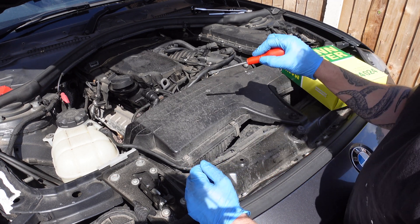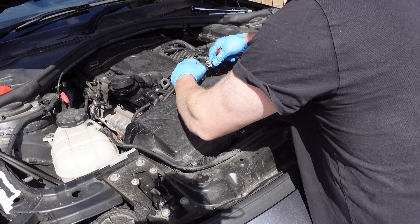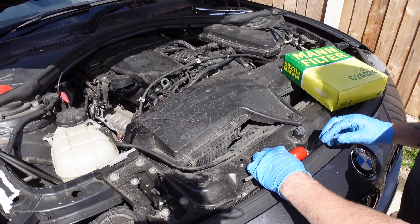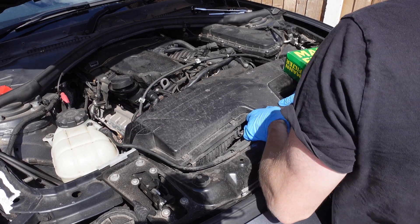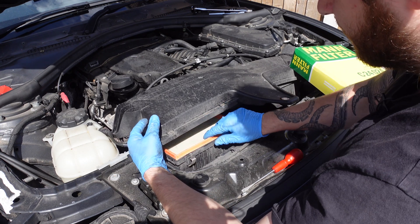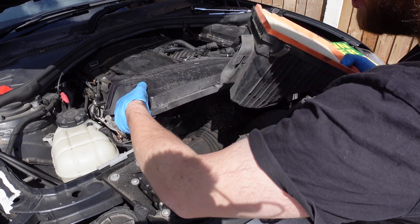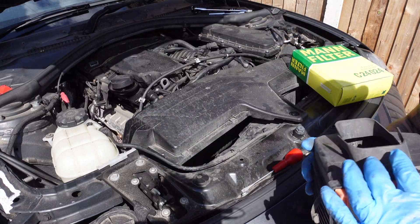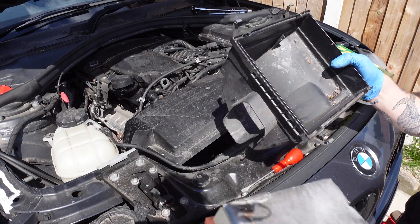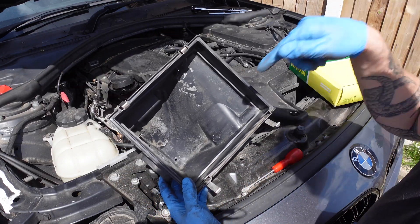While the last bits are draining out, I'm going to do the air filter — this is super easy. Just pop off these clips here, there's two on the front and two on the back. With a flat-headed screwdriver you might need to take off this wire as well. We've got rubber fixings here and here which you can just pull up. I'm going to pull the whole air box out — I guarantee under that air filter there's going to be some debris. Look at that — loads of grit and stuff in there. You can just get a hoover and stick it in there to hoover out all the rubbish.